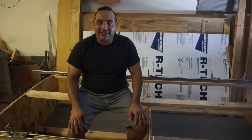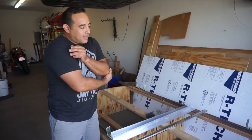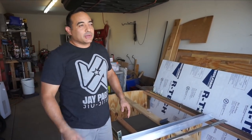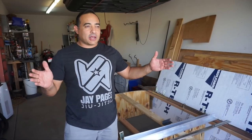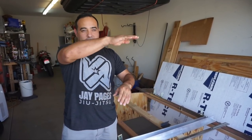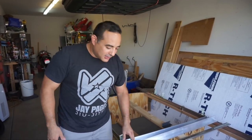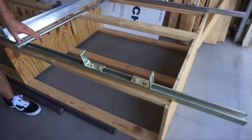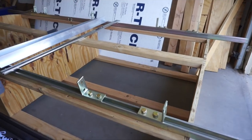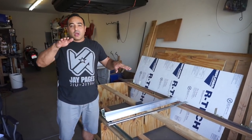The big unknown is whether we can actually do it. In this video we're tackling the lower layer. We were originally going to orient the panels the other way, but we've decided to orient them long-ways with the bus. The bus is about 35 feet long, but the relatively flat usable area is about 28 to 29 feet. We're using unistrut to flatten everything out and create a level, secure mounting point to build everything off of.